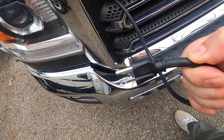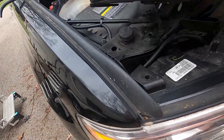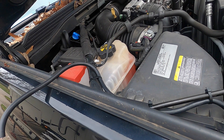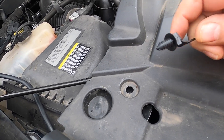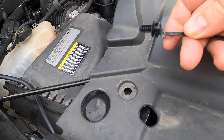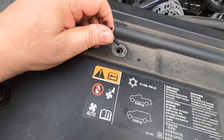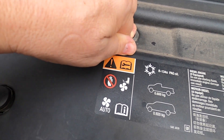I was not able to record the actual routing of the cable. It went from poking the cable through the grill, up and around the radiator, and finally terminating under the hood at the location of the heater plug. I also used one of the specialty cable ties — this one allows you to use an existing hole and push the cable tie into the hole to help secure the wire. I pushed the barb end of the cable tie into a hole like this one. Then to re-secure the radiator shroud, I just reinstalled those push pins.